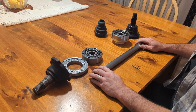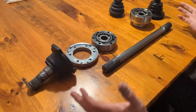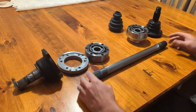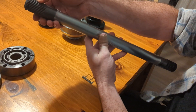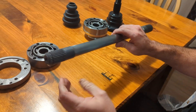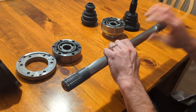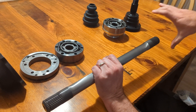This is a video of one of our latest axle revisions for the E46 chassis and a Nissan R200 diff. You've probably seen some of our axle configurations before, where we make a billet axle with a custom spline at each end. This can be configured for anything you like — traditionally for an outer CV for a BMW E46 or E30, and then a spline configured at the other end for a Nissan R200 CV joint.